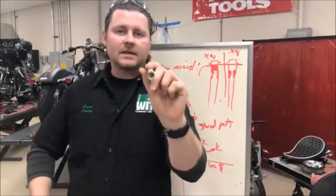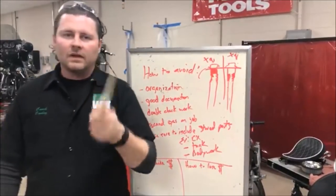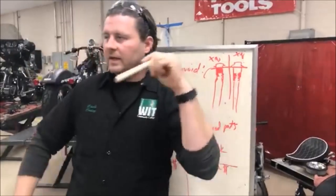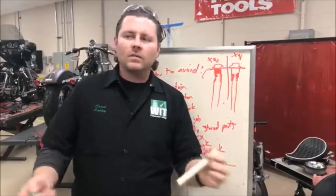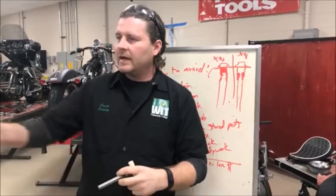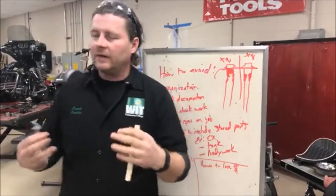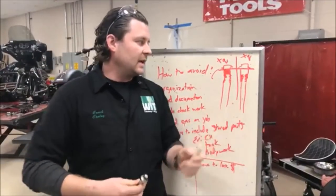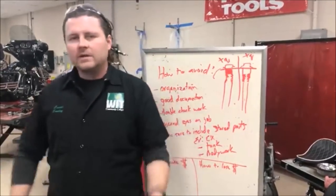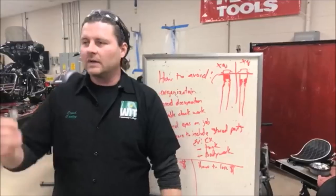And here's where the problem is, and listen to me on this. You guys gotta get this. Both of these, your torque wrench will click. You will get a false torque. If you don't use oil, you will get a false torque. So what's the only way to really do this right? Read the manual. You have to know what you're working with, right? You got to use those resources. Newer techs, myself, anybody. I mean, I feel like this is really important. I feel like fasteners not being torqued properly and not understanding this are big problems in the industry. And then you get a tech that says, well, I know I torqued it. Yeah, you might have torqued it and you might have got it to click, but you might have a false torque.